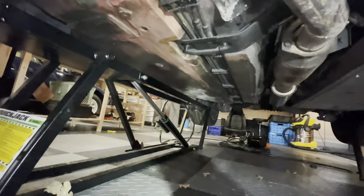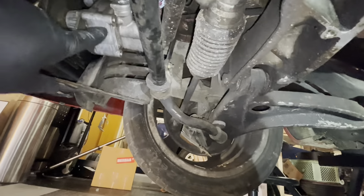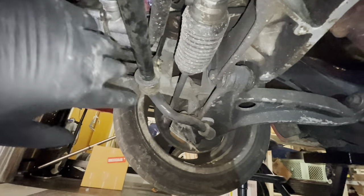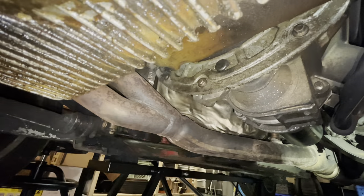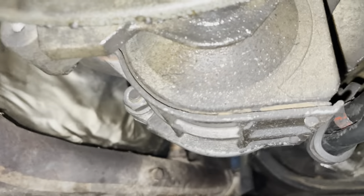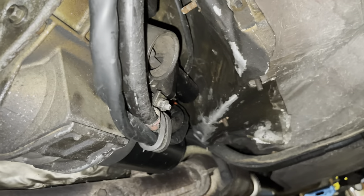One thing I'm picking up on this car that I didn't notice before: there's quite an oil slick going down here. You can see how oily these brake lines are — all of this is oil. Something on this car is leaking. I'm suspecting it's the power steering pump — that's most often what goes wrong, either the pump or the hydraulic lines. But that's a problem for another day. I want to get behind this little rubber plug — if I open that up I should be able to see the top dead center line. And yes, that's the top dead center mark right there. Let's take off the starter motor and get the flywheel lock in.